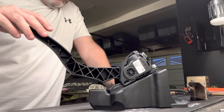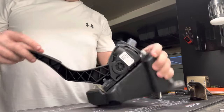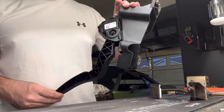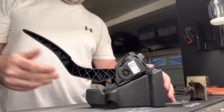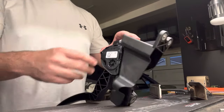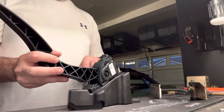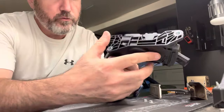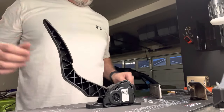So here's what we got for the new pedal. We've got this resistor potentiometer type thing here, and then this is the gas pedal. It's all a plastic assembly, and it's got this bracket that attaches to it — it's maybe supposed to go to the firewall on the Challengers and things like that. One of the problems is this base right here is a little too big to mount inside the car, and our wiring harness and bundling would be right in this area. So we're going to mount it without the weird base — take this base off and basically bolt it straight onto the firewall.